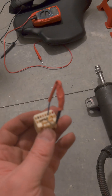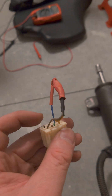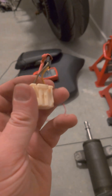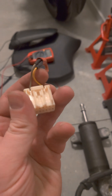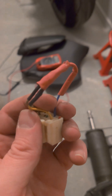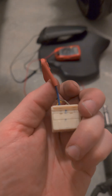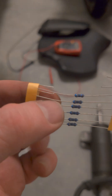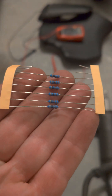What you need to do here is cut out and get rid of all the other cables. Take the gray and yellow wires — you need to put a 3 kilohm resistor on each of those wires and then connect the other end to the blue wire.